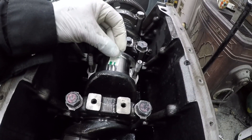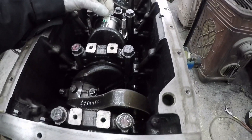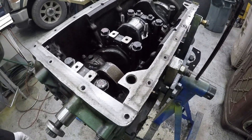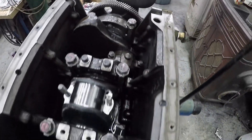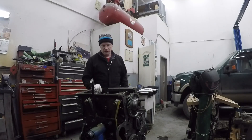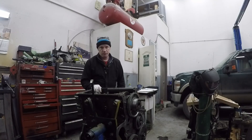There you have it guys — that's the plastigauge done. She's a thousandth of an inch, which is very tight, but I'll check the other journals now to make sure they're not any tighter than that. That's the install of the liners into the engine. Next on the list is to put in the governor, check the backlash on that, then put the rear cover on, the oil pan, then the head, and we're almost there.